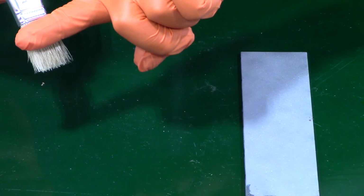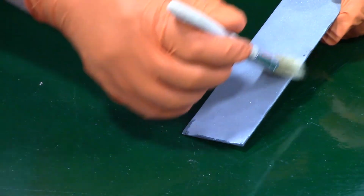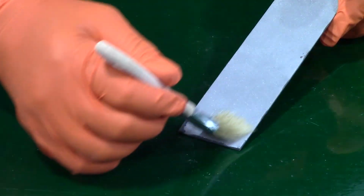Maintain a wet edge on the brush and paint with brush strokes going in one direction and stretch the paint out. Let the paint lay out and don't go back and forth overworking the brush. This is critical as overworking the brush causes the solvents in the paint to evaporate out too quickly.